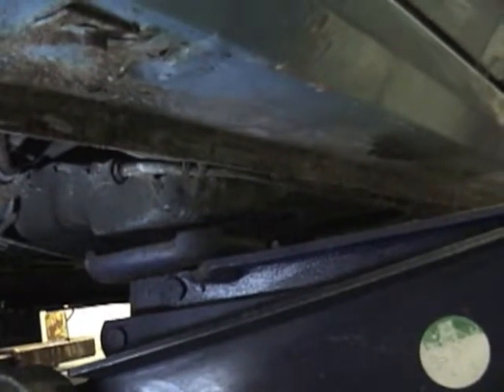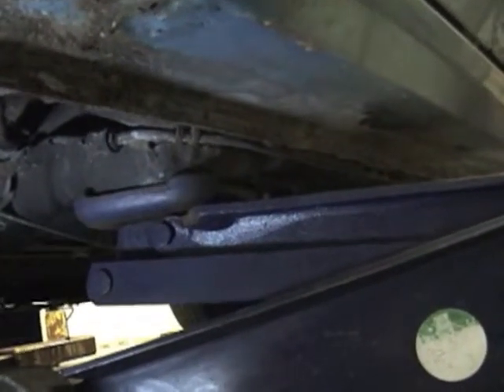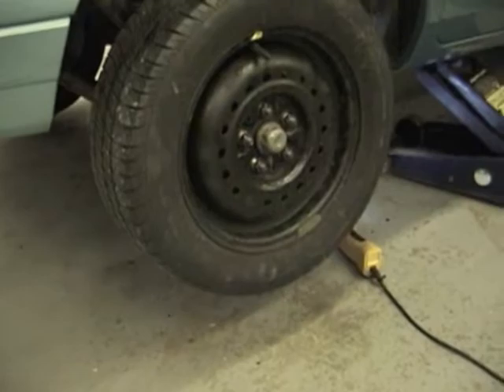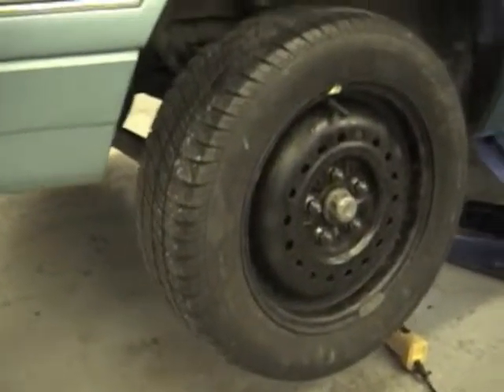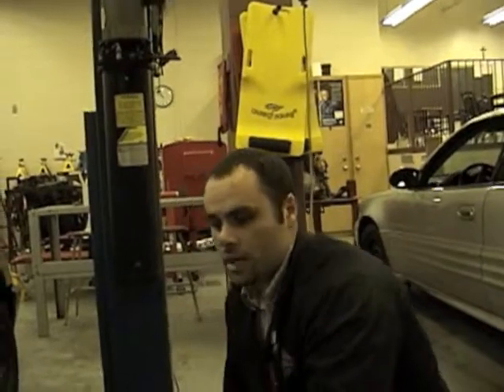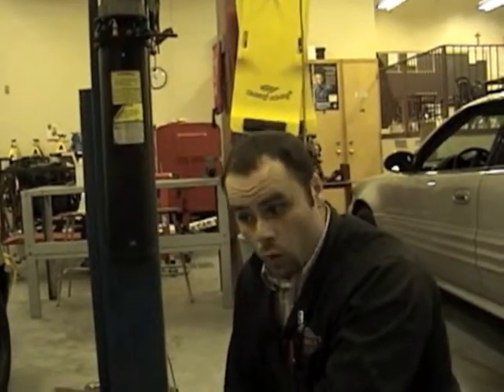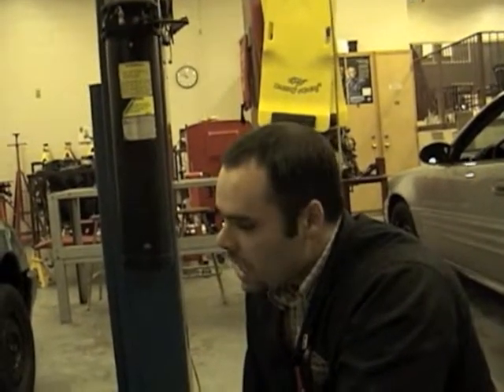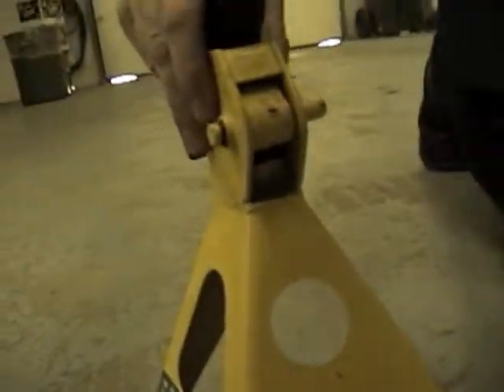The instructor confirmed this is the right spot, so I'm going to go ahead and raise the vehicle. You can see the wheel lifting. Now how high should I lift? I just want to lift high enough where I can put my safety stand under the vehicle. We must use a safety stand — hydraulic jacks including hoists are not designed to maintain the heavy weight of a vehicle for a long period of time. They are designed to lift a vehicle, so I have to use a safety stand.